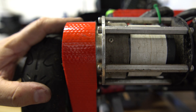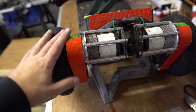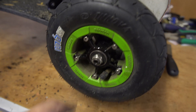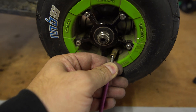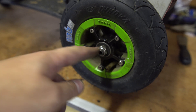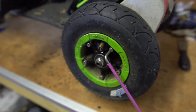As you can see, Scott's already made some improvements to his board. What we need to do is take out five of these bolts here — there's five of them going all the way around. This one's a pain because it's right close to the phase wires. But first you take the wheel off, and to do that we need to deflate it. Then loosen the superstar bolts and the main center nut — that's a 16mm nut.